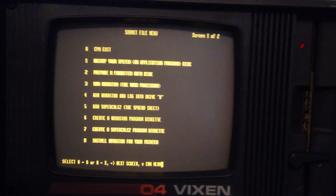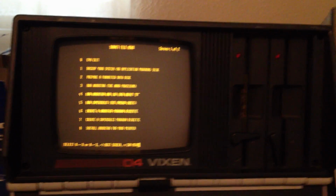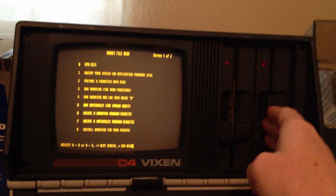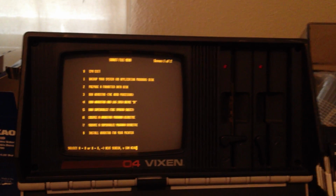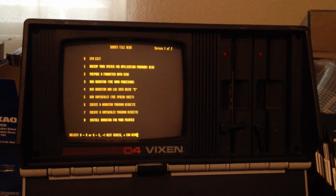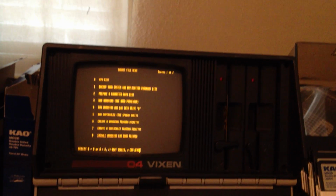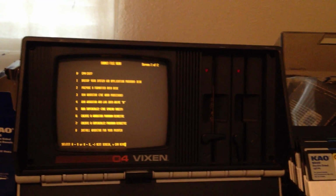Now, you wouldn't want to just do a disk track copy or sector copy from one drive to the other, just to get Wordstar on another disk and have a little bit of extra room to put some data on it without having to use the B drive for data as well. You would have to format a blank disk, put the operating system on the blank disk, configure the operating system to work with Wordstar, and et cetera, et cetera. And so then you would have to copy all these files, and you'd have to know which files to copy, and you'd have to know how to copy individual files, or with masks in CPM, which is a little bit tricky, especially for a new user.